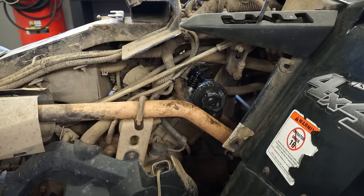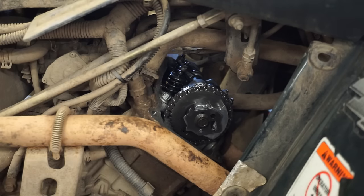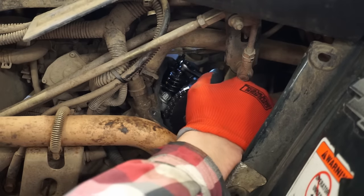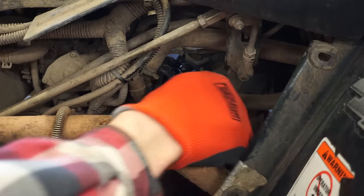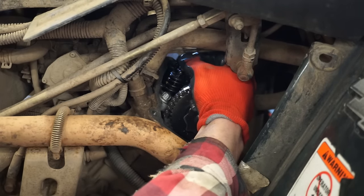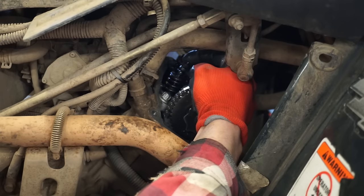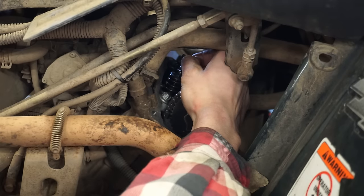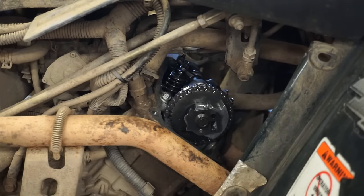Now those are really tight. So we're gonna set these to right around 4/1000ths of an inch. We'll set them to right there. Wrench. There we go. Loosen that up and then twist this screw out. And I think it's, yeah, she's locked in there pretty free.